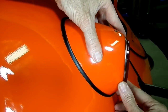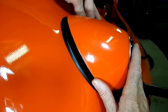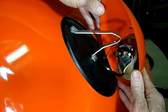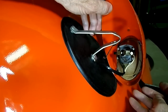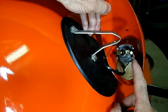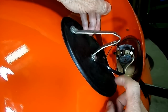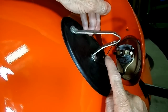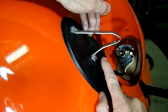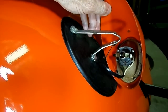We've got to be very careful here. Look at that. These wires screw in to the bulb holder right here. And then this piece right here, a piece of copper — see how it has a spring effect to it? That's the ground right there. That makes contact with the top of the bulb holder right there.